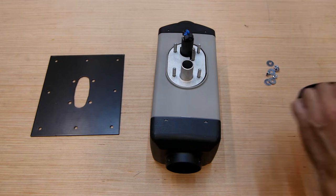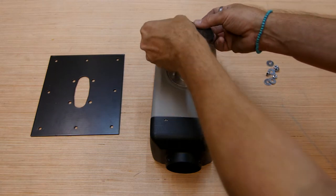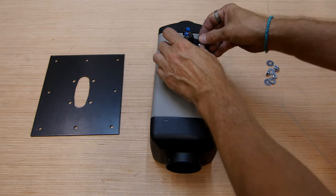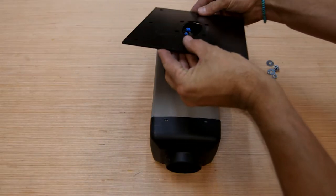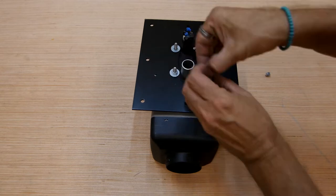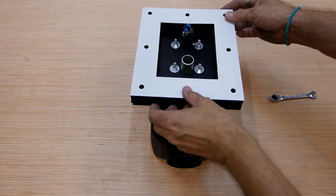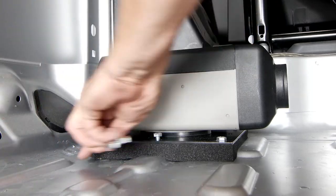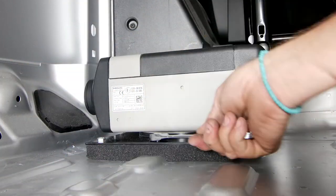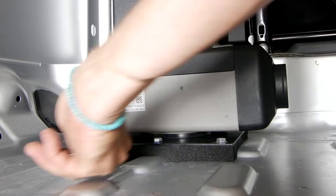Let's prep the heater for installation with what I call the sandwich. Turning the heater on its back, the first layer is the rubber gasket — it only fits one way. You have to align the hole for the fuel line correctly, with the side with the lip facing down. Next in the sandwich is the metal plate, then use the provided washer and nuts to tighten the plate against the gasket and heater with a 10-millimeter wrench. The last layer is the foam gasket, which will seal against the floor creating an airtight seal between the living space inside and the hole in the floor where the combustion intake and exhaust are outside the van.